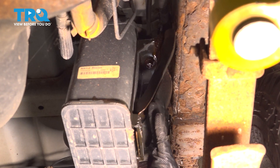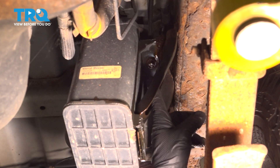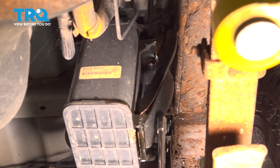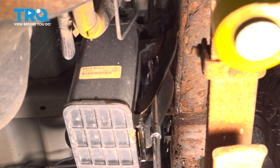On the outboard side of our canister, you're going to go up on the bracket and there is a 12-millimeter bolt right up here. You want to go ahead and loosen and remove this. There is a lot of debris on the top side — sand, all that stuff. We took our air hose and blew it off, and we sprayed it with a rust penetrant and let it set for a little bit.